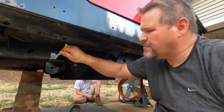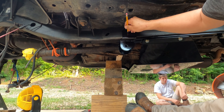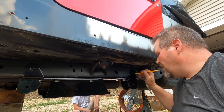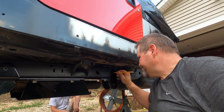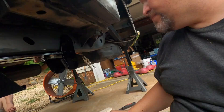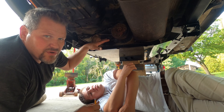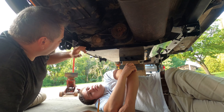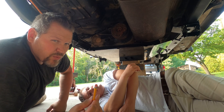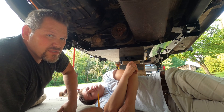We're over here on the other side of the frame and it's going to be exactly the same. We haven't removed our front drop drive shaft yet — Harley's going to go ahead and do that. We're also going to drop the brackets on the back of the exhaust and try to get it to tip down some to help us with drilling. On the exhaust hanger and muffler hanger bolts, they're 13 millimeters. I already took the two on the back side of the frame out, and I'm doing these two now — I already took the bottom one out and I'm working on the top one.